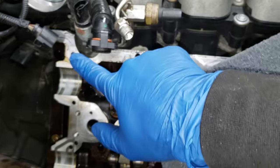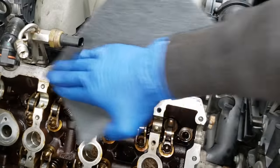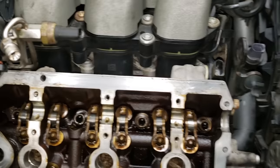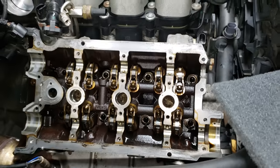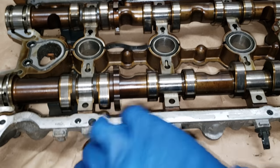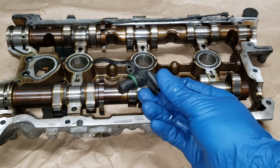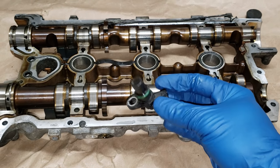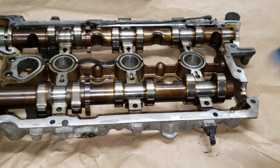We got the pieces of the screwdriver I cut. They're inserted from the bottom so they don't get pushed back out, and they actually work perfectly. They're exactly the size I need — it might as well be factory pins. Now you're going to want to remove any remaining gasket material all through the outside edge here. A little brake cleaner and a little scrubbing on top, and you'll want a nice clean surface all throughout. Also, make sure you remove your camshaft position sensors before cleaning — great time to replace these as well, they're pretty inexpensive and easy to replace. There will be a link below for some of these parts.